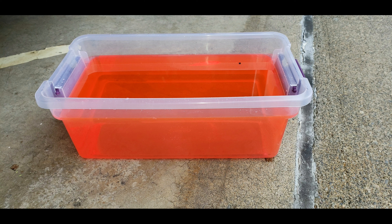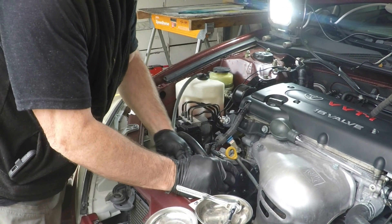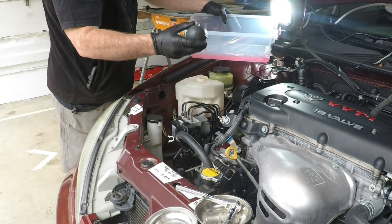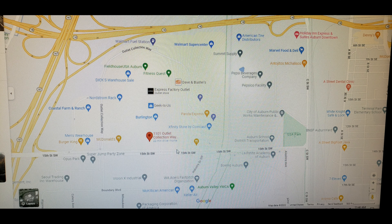After about two hours, this is what it looked like. While waiting, I went to the Haynes manual to figure out how much fluid I need to put back in. I found the engine size on the emissions control sticker, which told me I need 6.2 quarts — not including the overflow reservoir. To change as much fluid as possible, remove the overflow hose and drain it, then use a turkey baster to drain the overflow tank. Since antifreeze is poisonous, get her a new turkey baster afterward. The radiator fluid needs to be dropped off at a hazardous waste disposal site.